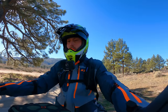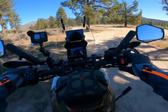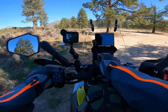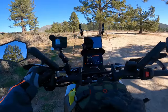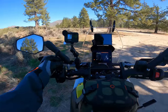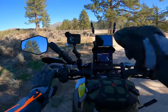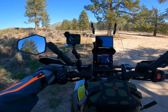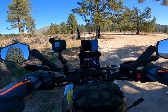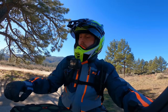For riding the bike off-road, there are a few things you need to know. The riding modes, which you can change on the fly, are right here with this button — I've talked about that in another video. I have off-road modes set up with rear ABS disabled; the front ABS is left on. When you select the traction control on the dashboard, you can scroll through four different levels or turn it off using the cruise control button — very handy. We'll leave it in level one for now and show you how that is. When we get into sand, we're going to turn that completely off.